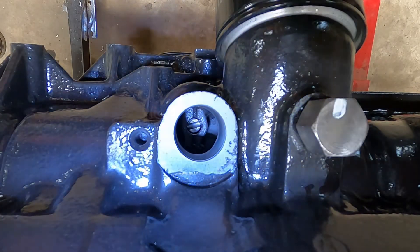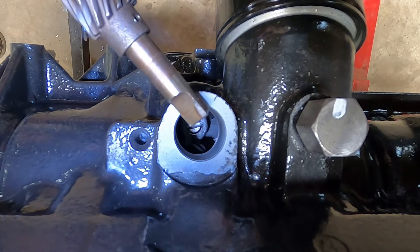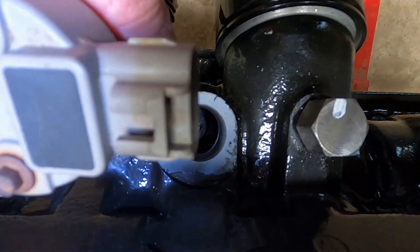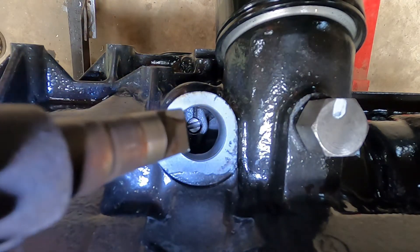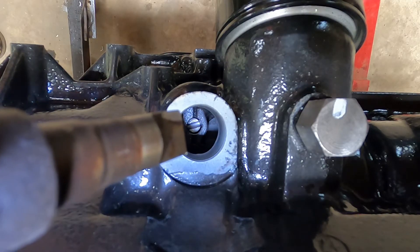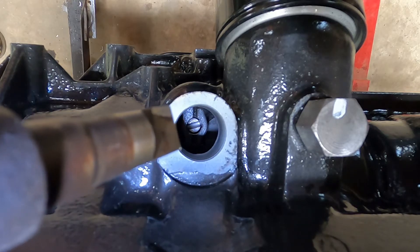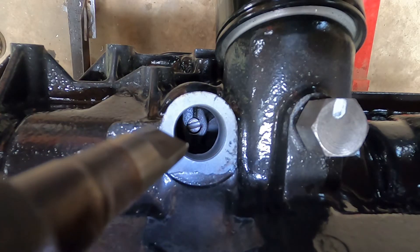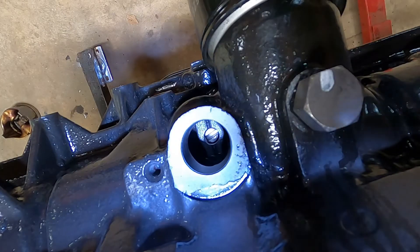The other thing to note is that at the bottom you can see the tip of the oil pump sticking out. This tip of the oil pump drive needs to align with that slot. With the sensor pointing directly backwards, the tip of the oil pump drive will not be aligned with the oil pump below. So the first thing we need to do is rotate that oil pump to make sure it is aligned with the tip — remembering we'll be starting at roughly the seven o'clock direction as we rotate down.